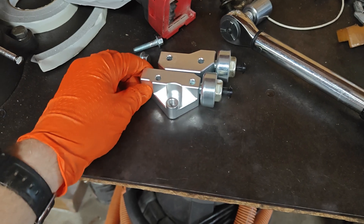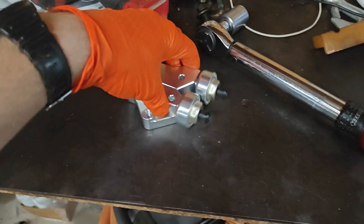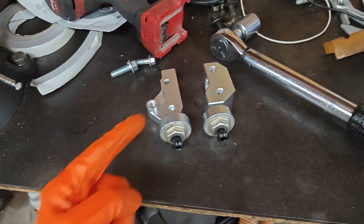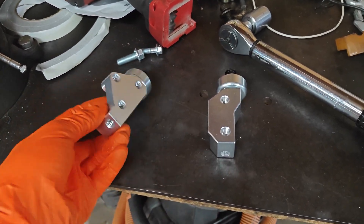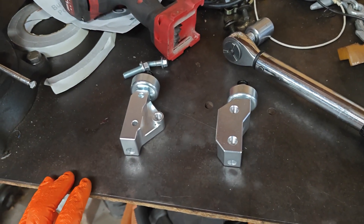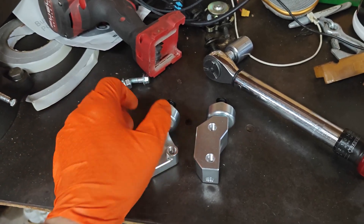There are a couple of different knock sensors that I recommend — I'll put them down below. This is how I like to put them in: this is the rear threading, and this is going to put the sensor towards the back of the engine where they're going to be installed. That's going to keep these things away from road grime and debris as much as possible. This works on two and four-wheel drive.